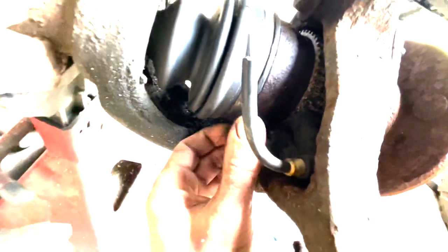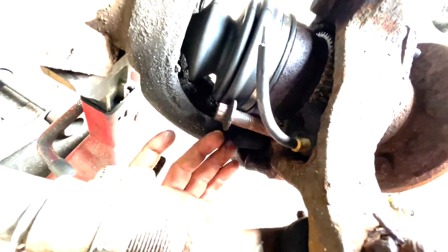We just haven't gotten to that, but she wanted to make this thing look a little bit more pretty in here, so we have that. And then we are now working on doing ball joints and unit bearings or hubs. You guys can see I've already started taking this thing apart. I've got the brake caliper off and I've actually removed one of the bolts here for the hub. Got that guy coming out, but I've done the passenger side.